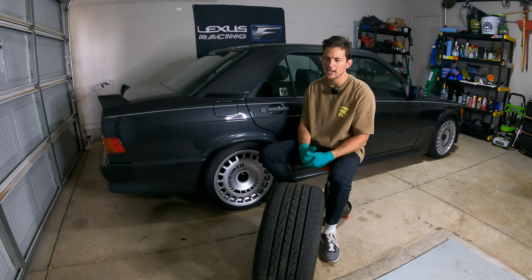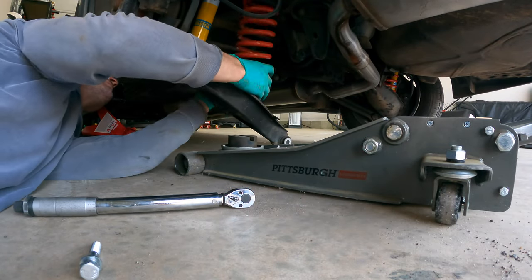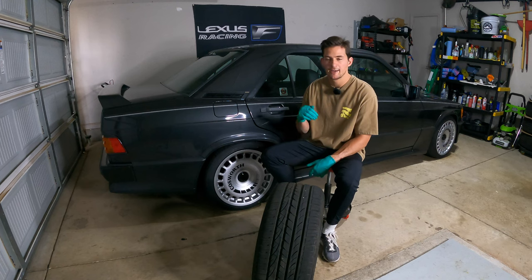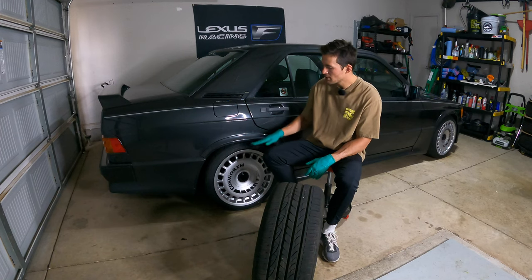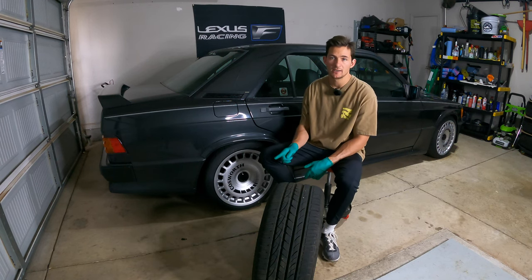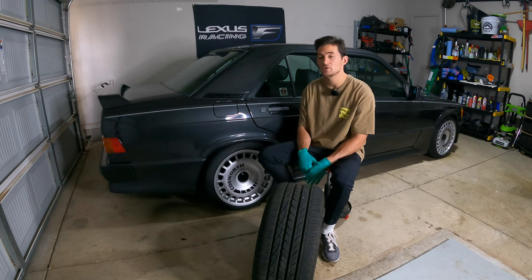To fix this, I found the H&R lowering springs for a 2.3 non-16-valve car and installed them. I was nervous because the H&R catalog said one spring would be dark cherry and the other a vibrant red — but when I set them next to each other the colors were almost identical, so I was worried I'd ordered wrong. I trudged forward and installed the 2.3 normal springs, not the Cosworth ones, and dropped the car. It looked identical to before, so I was still worried, but on a test drive I could go over any bump and the rear would not scrape. Main takeaway: if you delete your SLS system, the standard Cosworth springs are not strong enough if you have anything over the stock tire's rolling diameter.